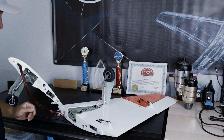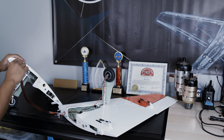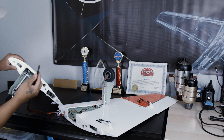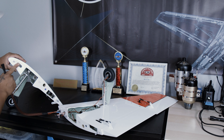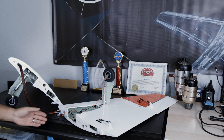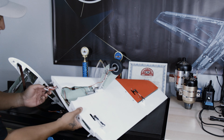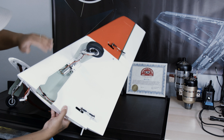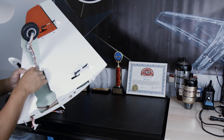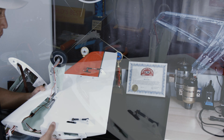Here's the wing of the Bayhawk. The right wing I've already gotten started with the connections. Here's that single MPX connector with eight pins. It looks a lot cleaner having just the flush-mounted MPX eight-pin connector there, and when you set up at the field it's just one single connection. Here is the left wing that I haven't gotten started yet — right now I've still got four separate leads and it kind of looks like a mess. I'm going to neatly organize this and make it look a lot more presentable.